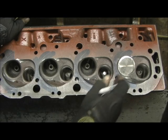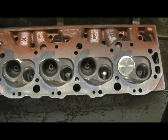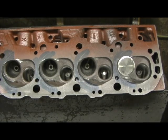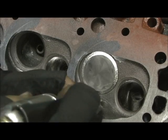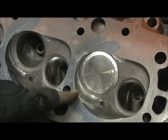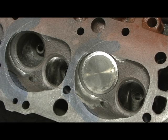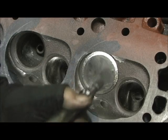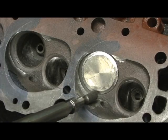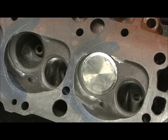The heavy material removal I'm doing with the big cylinder comes to that point. You can see the dip or the crevice from where I was in there grinding — taking some of this flame quench top pad away. While it isn't quench, it has a lot to do with burn but it's just shrouding that area too much. So I go in here — be careful, don't go crazy — because I have seen people bust through these chambers, and with a sharp edge like this it's real easy to do.